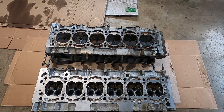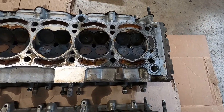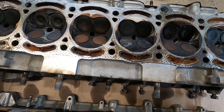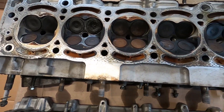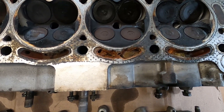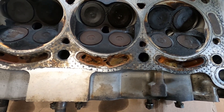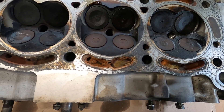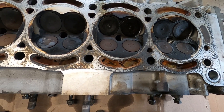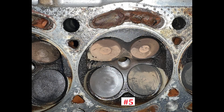Here's what I found after looking at the old cylinder head. Corrosion is found around the exhaust side cooling ports. The coolant port at cylinder head number five is especially worn and very close to the combustion chamber, and by looking at the head gasket it looks like combustion gases have been escaping into the coolant port past the sealing ring.